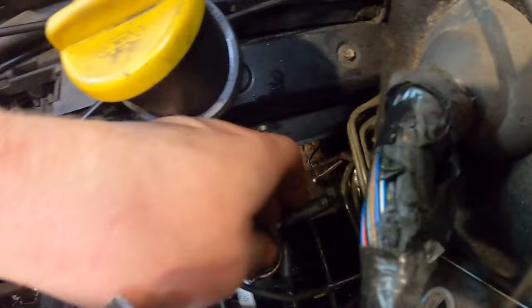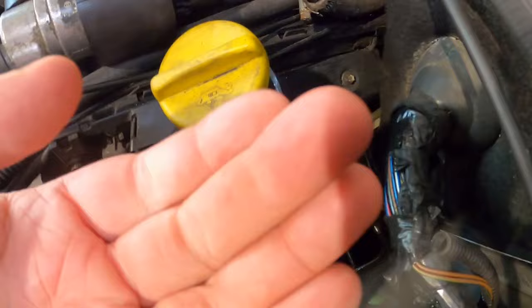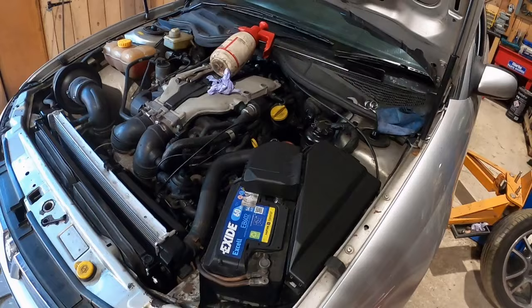Okay, so the stopper's in, you can see there. I just wanted to give you another reason for this stopper, not just about the brakes leaking. You can feel now, make sure it's dry and make sure nothing's leaking. And the reason you're doing that after you've tightened that stopper up is to make sure that it's not the threads inside the ABS pump that have gone, and it's the threads inside the brake pipe. So there you go. Now to make a brake pipe.